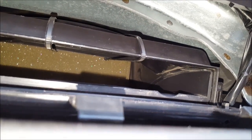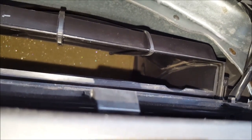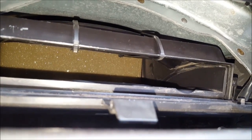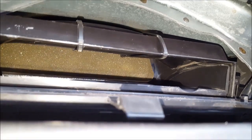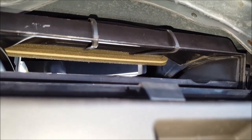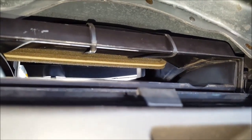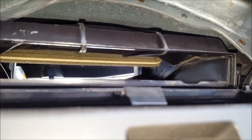We are back and as you can see I have both of the notches from the zip ties up against there. We're going to close this door and watch what magically happens — it hits it and it doesn't hit that gear. No more annoying 10 to 15 second click noise every morning when you start your car. There's your redneck fix for you and I hope you guys appreciate it.